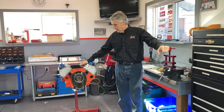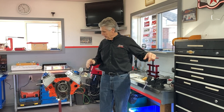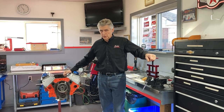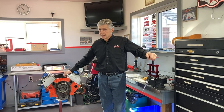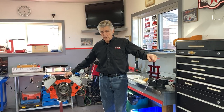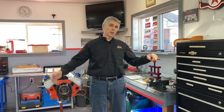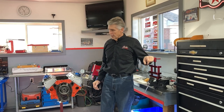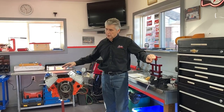Hey, welcome to Gold's Garage. The subject of this video today is the shootout of rocker arms. If you've watched my videos before, one of the things I like to do, especially with small camshafts, is to use a 1.6 rocker arm ratio because it increases your lift everywhere and helps everywhere. As opposed to duration, it doesn't hurt your low end performance, doesn't hurt your idle quality or anything like that. It just gives you more air into the engine and makes more power. So just a little background before we get into that - we're going to give you a complete demonstration of how we do it and the results.